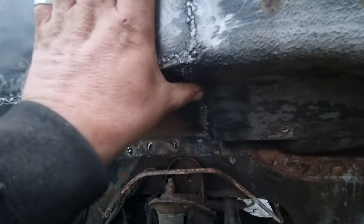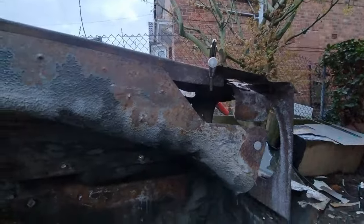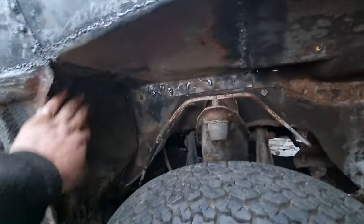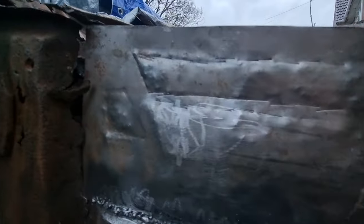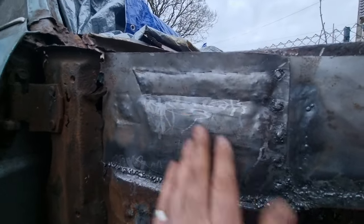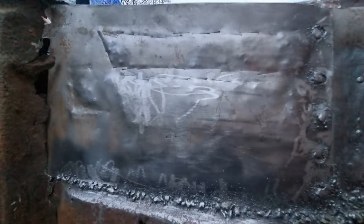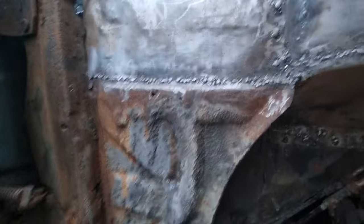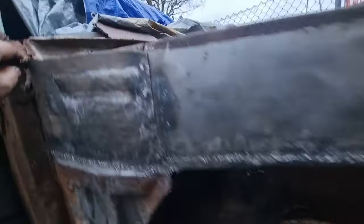I'm getting some really good welds now. There's a few little pin holes I've still got to get through, but I'm just glad that this is done. So chuffed! Can't wait to sand all this in here and paint it. I know they're not exactly like the originals, but at least I've got some this time. Before, the other plate that someone else put in didn't have anything — it was just straight plate. But from looking on the internet, these panels are meant to have some indents up here for strength.